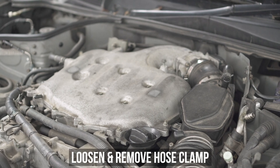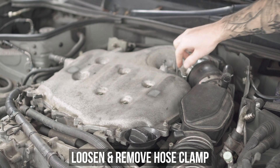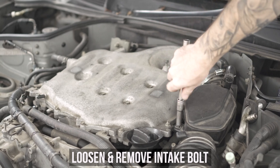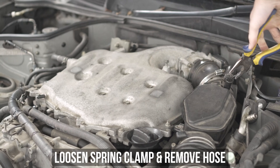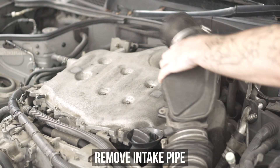Now to install, pop the hood — aka the bonnet — prop that sucker up, then loosen and slide down the intake pipe hose clamp. Now remove the bolt that's holding it to the uber-boring non-spaced-up intake manifold, then unspring the spring clamp and wiggle the hose off your air box and bend that sucker all the way to the side for now.